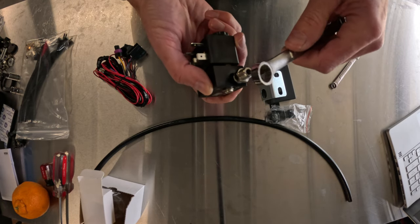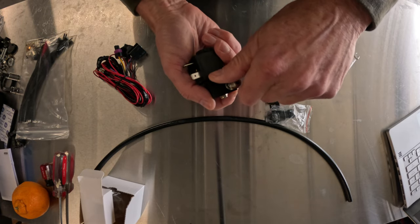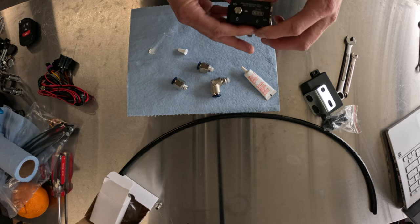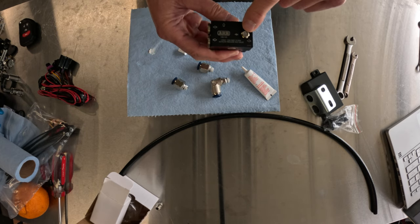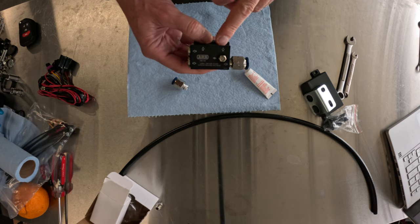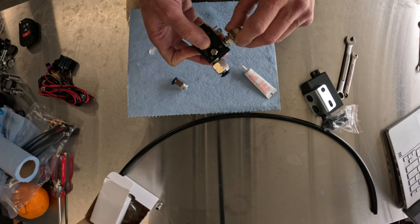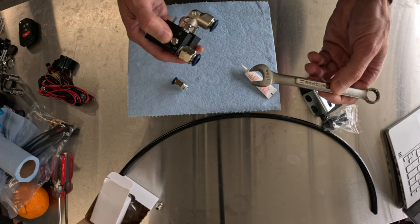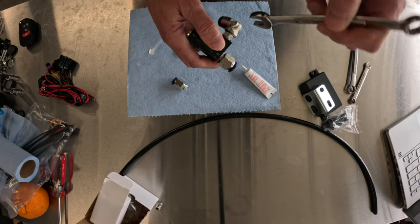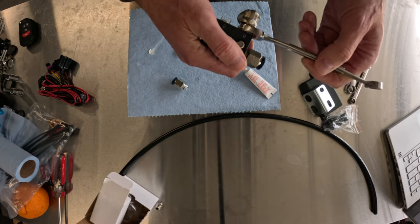We're not going to need this male pipe fitting at all, so we'll take that off — 12 millimeter wrench. Right next to the port where we snugged things up, we're actually going to put one of the straight fittings. There used to be a straight one coming out of the top here; they give you an elbow now and that's going to be going to the other side. It's a 13 millimeter for this one, and don't freaking over-crank it because you don't want to crush that o-ring.